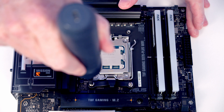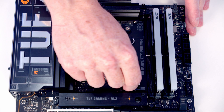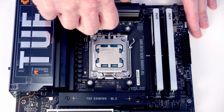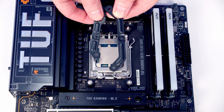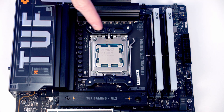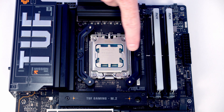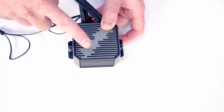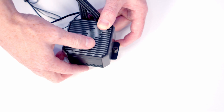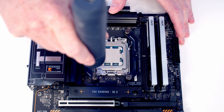Next we remove the stock clips from the motherboard — each held on with two screws — and install a stud bolt onto each corner. The stud bolt has two different thread sizes and it's the larger thread that screws into the motherboard. A small spanner is included in the box which is helpful for removal. We get two different brackets for AM4 and AM5 sockets. The shorter brackets position the cooler screws at the top and bottom of the motherboard, while the longer brackets position them at either side. Since we want the tubes running side to side, we'll use the longer brackets and add a thumb screw to each corner.